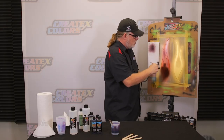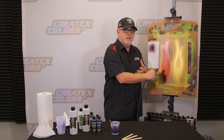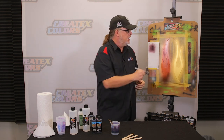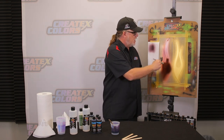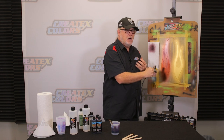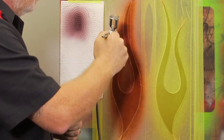Now you may wonder, why am I going over gold on this? I'm sorry, I'll just keep on blowing air on here as I talk. The reason I'm going gold is that usually when people refer to candies, you always hear the term candy apple. They're like, oh, I want to do candy apple red, candy apple green, candy apple violet, or candy apple cherry red. Anytime you use the term candy apple, that is going over a gold metallic base. The original guy, Joe Bailon, who came up with it, was trying to imitate a candy apple. And a red candy apple is actually over a very golden delicious base, a very light colored yellow or gold base.